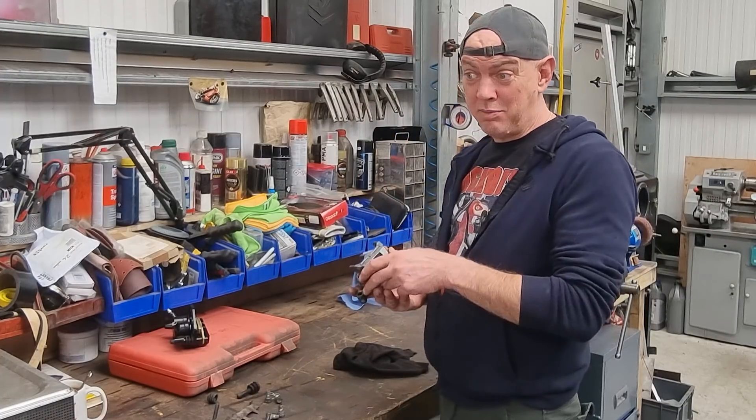So these calipers are going back together as is. Here are the old nasty pads - won't be using them. I might use the springs though - we'll give these a clean up because they're absolutely fine. I've got some new springs, genuine parts and stuff, but I'm probably not going to fit them until I do the proper rebuild. I'm going to get a service kit, split these, get them painted. I want to replace these bolts because they're obviously rusted, but they'll do for now.